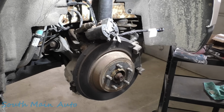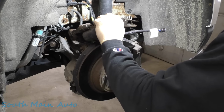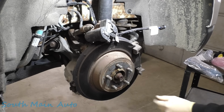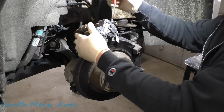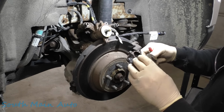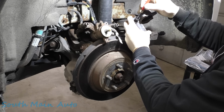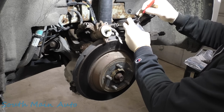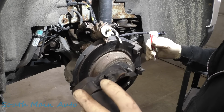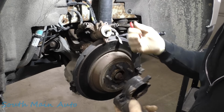There's one bolt. There's bolt number 2. See how stuck it is, if we can just give it a wiggle here. There she is, boys. Yeah, she's pretty crusty on that pin. I don't know, it may have worked, but I just didn't want to stick a new terminal or a new wiring harness on there with the corrosion growing on that pin. Because if it is down inside the motor assembly, it's just going to continue to migrate right back up that harness.